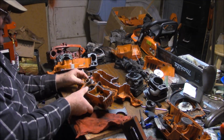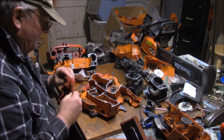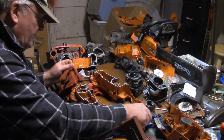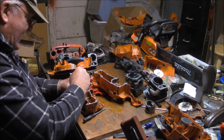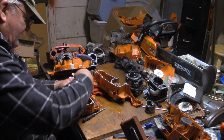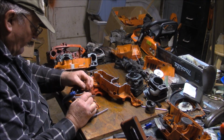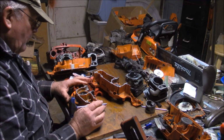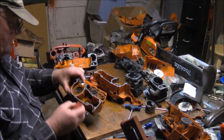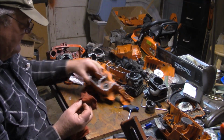And those bearings are hard, you know? Instead of taking an abrasive or something like that, that's as hard or almost as hard as they are to hurt them. And grease and gummy stuff like this is not something that's going to hurt those bearings in little doses. It'd take a lot of doses to make it really hurt them. And what would get them is not so much the material passing through, that's usually softer than the metal they are. What would hurt them is the degradation in the lubrication. That's what's going to get them. But I'm going to get it out of there anyway. So that's good enough. Get this side here.